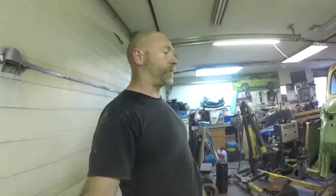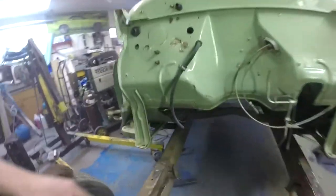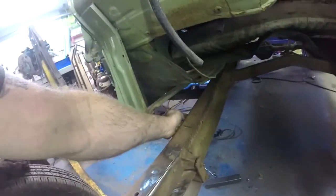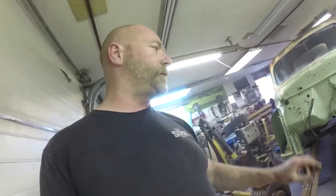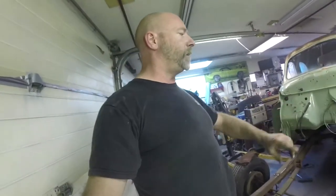That actually went okay. I've got to go over my welds a little bit, and I do have to finish welding them all the way around. Like I said, shore up the rear, gusset them up a little bit, and I've got to triangulate from the mount down to the frame at the lower section to give it some more strength. And I think when I'm all said and done and I get the other four mid mounts made, I'm going to run a bar to tie in all along the outside length. Just again, a little more added strength.